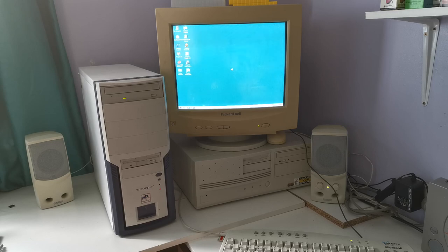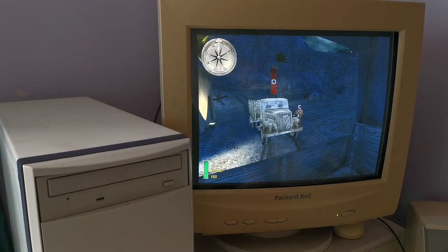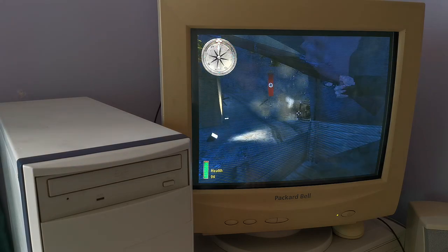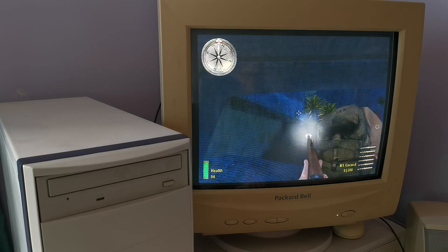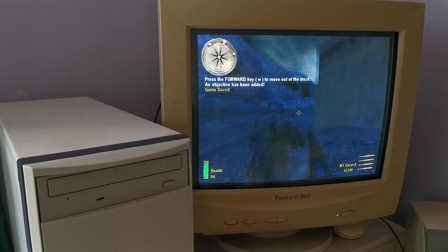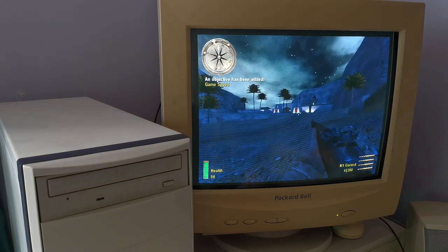And yes, some of you may have noticed there's some different chimes going on there. What I had to do, which I didn't film again because I've already done enough installing on this video, was I loaded Windows 98 SE from scratch, because what I didn't realize was when I did that upgrade that it had kept the original DOS partition. So I had like a 2 GB DOS partition and no way of extending it that I can think of, short of getting hold of some kind of third-party partitioning software. So I just thought, screw it, flattened everything and reinstalled Windows 98 SE. That was a nice experience doing that upgrade.